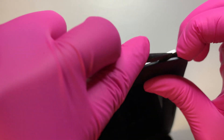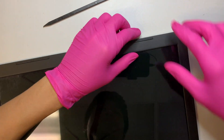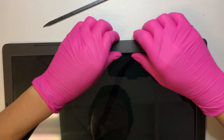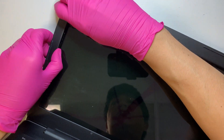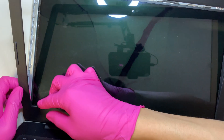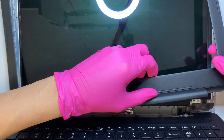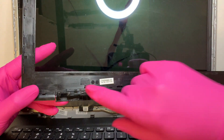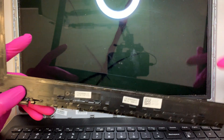What you want to do is get some opening — you want to hear that cracking noise. That means you're separating the bezel away from the back plate. Go ahead and be gentle, slowly lift it up. While you're doing that you can also feel yourself separating that double-sided tape. As you can see the tape is still here; some of it is still sticky.